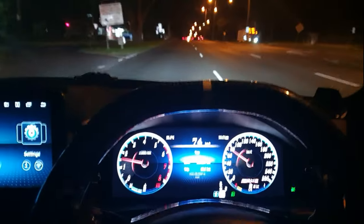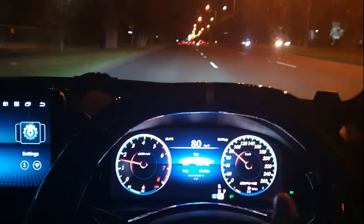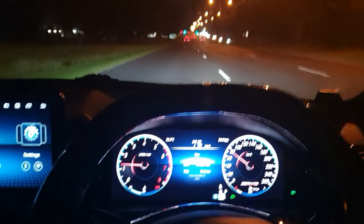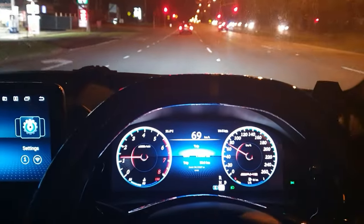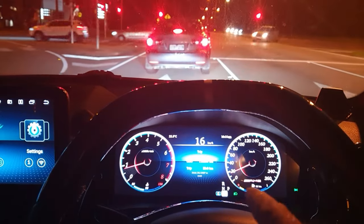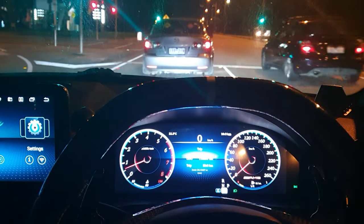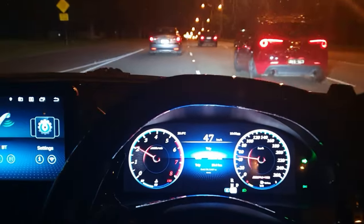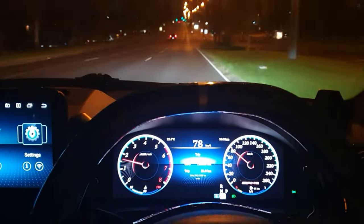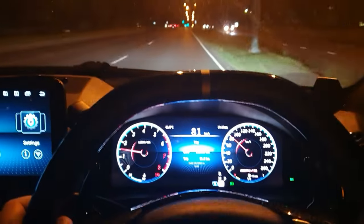Let's see if it is in sync with the trip. Right now it's on 9.4 k's. Once we get to 116,654 — when it goes to 55 — let's see if it matches. There we go, 55 now and it's on 20 kilometers. If it goes to 21 kilometers and reads 116,656 then we know the reading is correct. Okay, 56 and we are on 21 — that is perfect. You can tell it works really well.